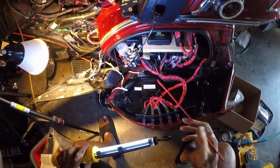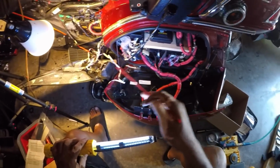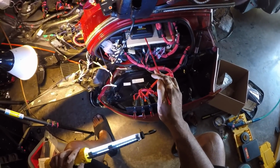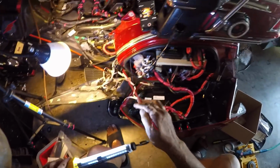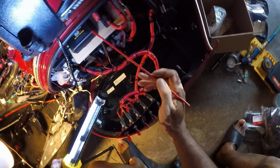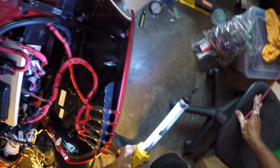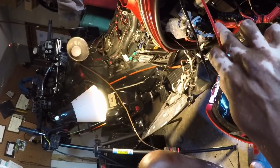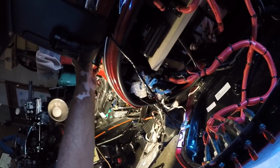Now, from what I understand, when the battery is connected, when the connection is complete, the isolator should be in a red solid status mode, in the isolator mode, indicating that the batteries are separated. So there should be a red light in the back there. I should have turned this isolator the other way so I wouldn't have to be looking all up inside the saddlebag. But if you see the red light right there, I'm hoping. I'll turn my helmet so you can see it. I'm trying to look at the camera and see if y'all can see this or not.